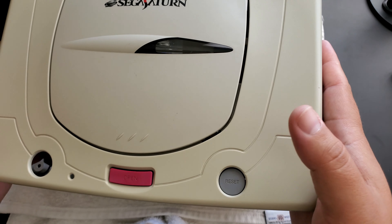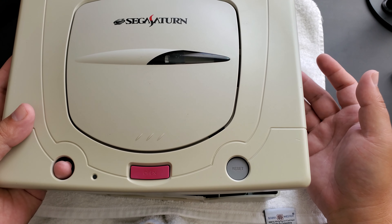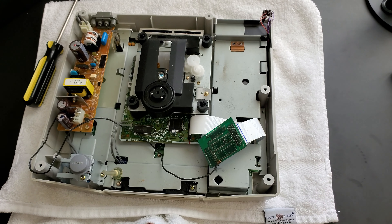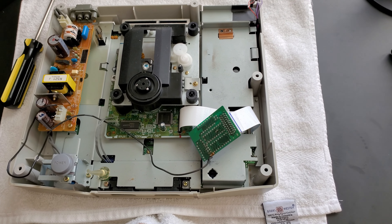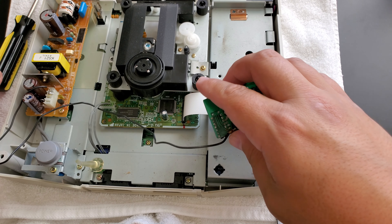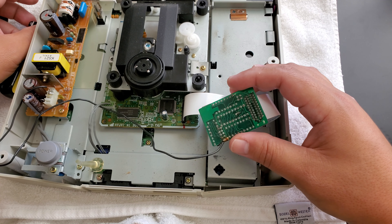There's only a power-on LED, whereas the Revision 1 units — the launch units — had both a power-on LED and a disk access LED that flashed. By the way, for those wondering, the discoloration on the shell is just due to oxidation of the specific plastic used for this mold. This is a problem that plagued the Super Nintendo as well, and it can be reversed by bathing it in a mixture of hydrogen peroxide and UV light. There are many procedures on YouTube to restore that, or we might just get a replacement shell altogether.